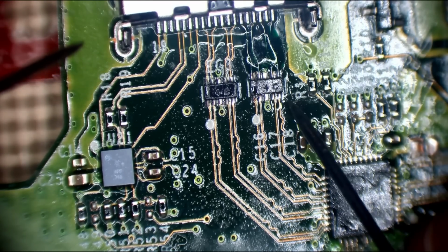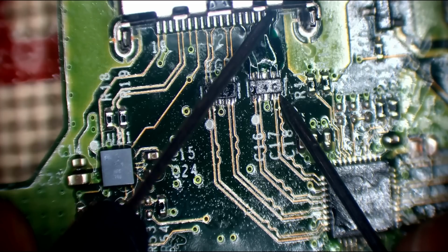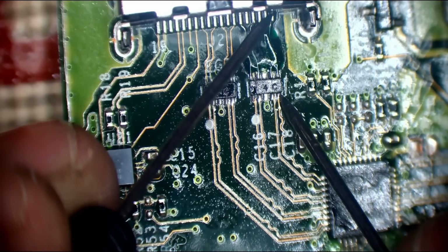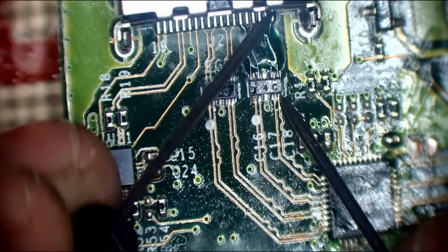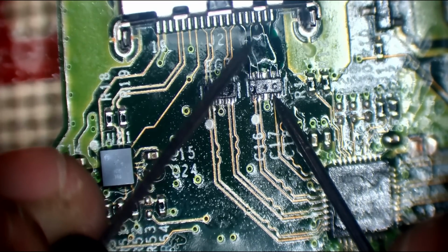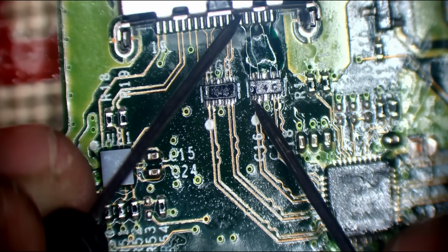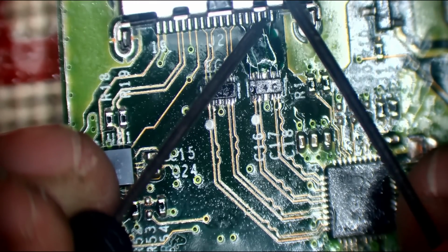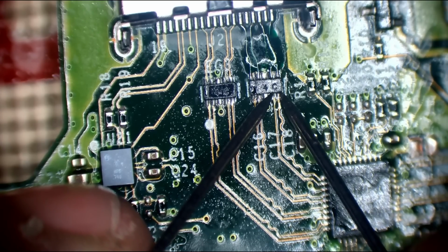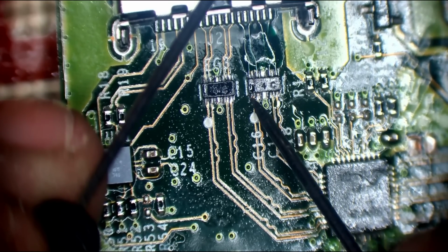And if I probe the bottom of this filter and the top of the pin, I haven't got beep mode on, damn it. Let me turn the beeper back on. Yep, so as you can see, we've got continuity on the top of the pin, which means that the actual jumper wire is soldered. Same as that one. That one. And I'm only pressing really lightly so I'm not pushing down on the pin as well. Yeah, so we've got continuity on them. That one there and that one there are ground. No bridge there. No bridge there. No short to ground. No short to ground. No short to ground. And no short to ground.